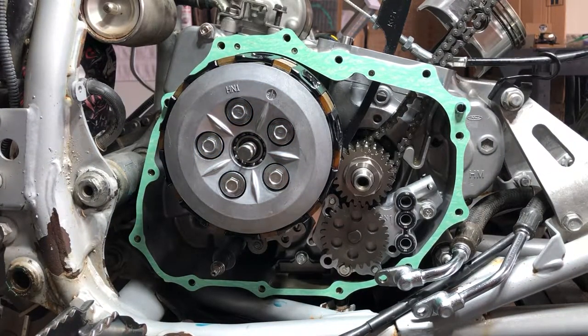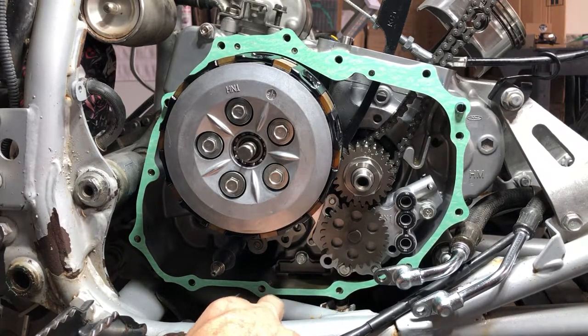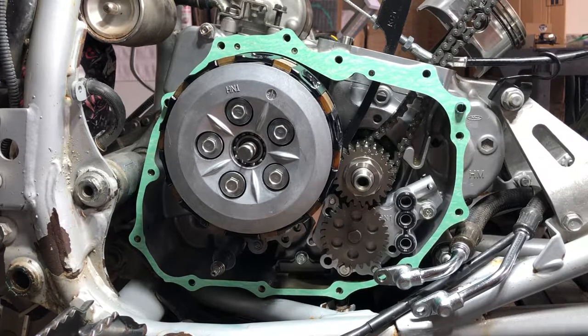That's because I greased the gaskets on the way in the first time. And there you go. Then the gaskets come off beautiful. And technically, I could have reused it. But they were shit gaskets. So these are the OEM, brand new, from Honda. And we're not messing around with any of those shitty gaskets, because that's why we're in this predicament in the first place. We're replacing this base gasket and the head gasket, because they were pieces of crapola. So anyway, yeah. Now, we're ready to throw this cover on there.